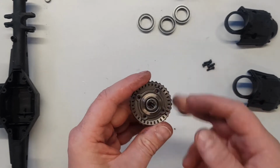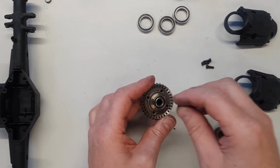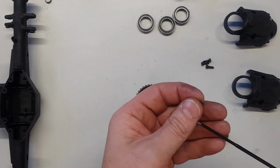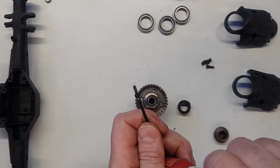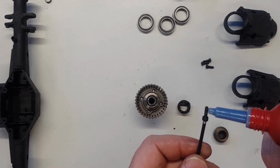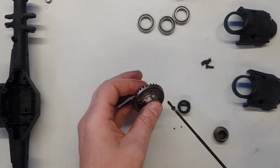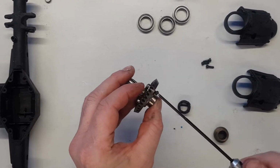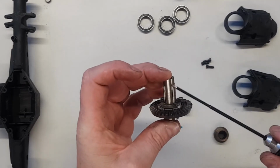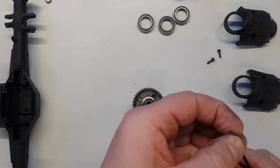Now, I don't know if you remember, when I took the other one apart, these bolts were actually a little loose. So what I'm going to do is put a small amount of thread lock on them. 2mm hex. I always use blue thread lock or Loctite. Loctite's actually the brand name rather than the product. But if you do use a different one, if you can get red, but red is actually designed to not come undone, whereas you do want to get these undone, because again, this is a part that you don't get with your diff gear, and that shouldn't have any problems without wearing. So we just put these four in.